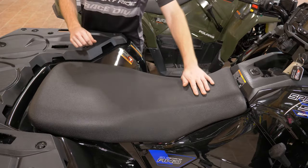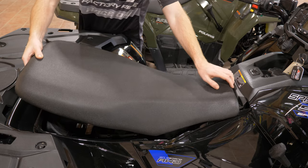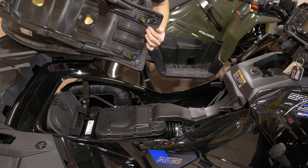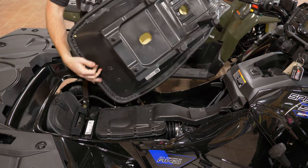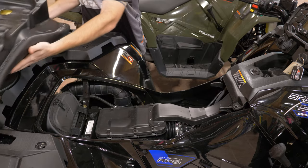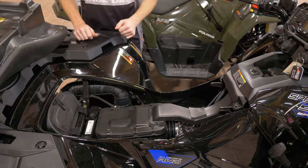The Sportsman seats are easily removable. You pull up on the rear and pull back on the front. There are two tabs locking into the front part of the seat, along with two little darts in the back that go into some rubber plungers. There are no levers to remove it — you just pull up on it firmly.